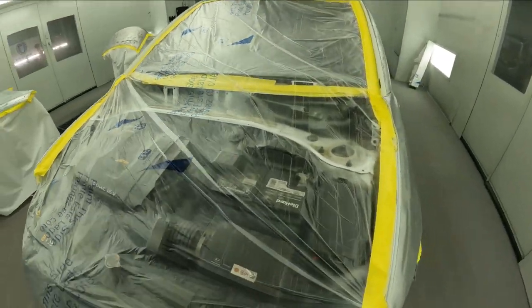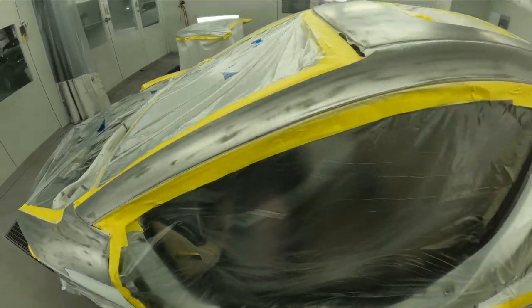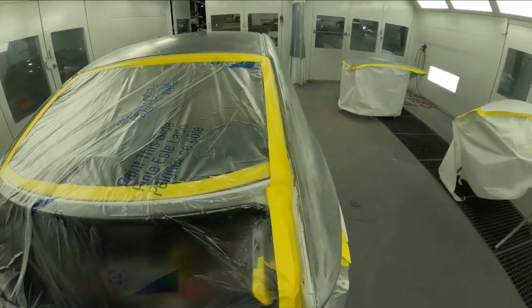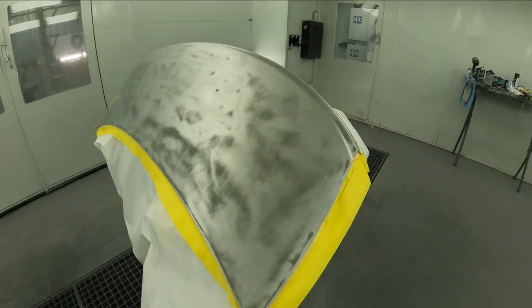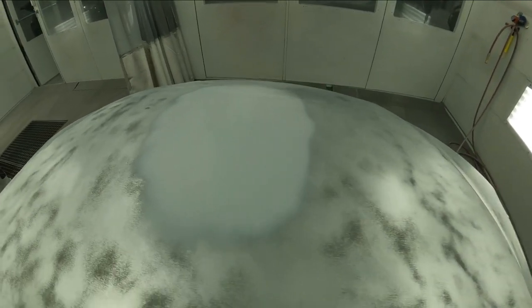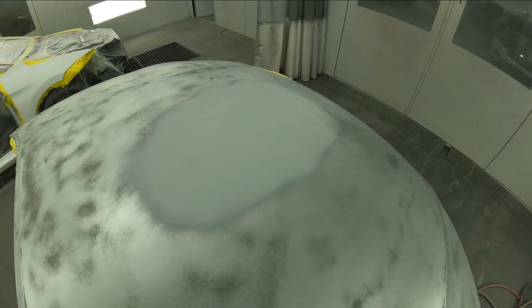You wanna make sure that you get it all the way down to the metal and you don't have any leftover paint. You guys see here, we have it stripped all the way down to bare metal. We also have the hood and the trunk on this one. Bare metal, and we have bare metal. There was a spot we went ahead and did for free, and we hit it with some primer last night, and we fixed that little spot on the hood for the customer just to give them a nicer job.